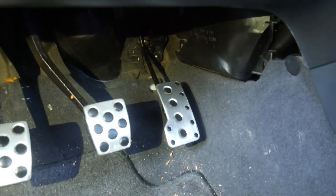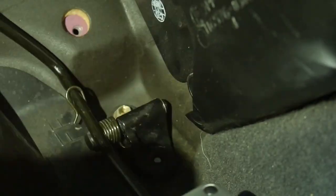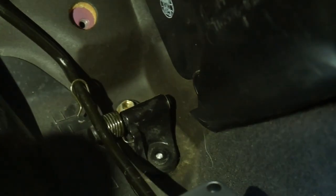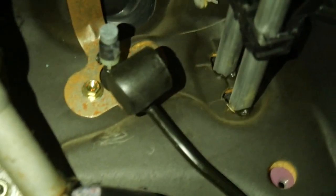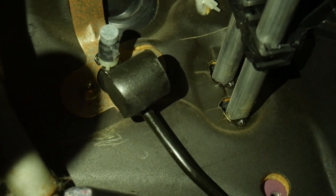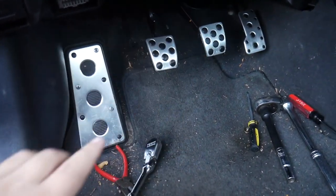Because of how small the space is, it's pretty much impossible for me to record myself putting everything back together. But since I'm not working on the car now, I can show you what I'm talking about. Because my bolt broke, I went for the C-clip on that side — I popped that off and pulled the whole pedal assembly out from the bracket. Up here, that's where the cable connects to the throttle. There's a small clip behind it; you pop that piece off and move it out. Then the whole pedal just comes off. This is a drive-by-cable car, so the cable attaches there. Electronic throttle is a little easier since it's just a plug rather than a cable.